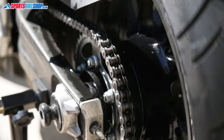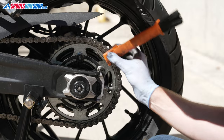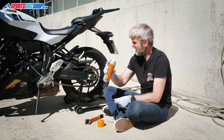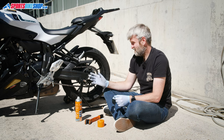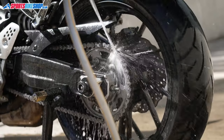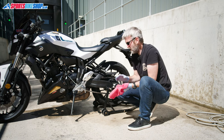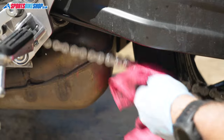Then just go around the whole chain — hold the brush and spin the wheel through it — to give yourself that extra lap and pick up anything you might have missed on the first circuit. Once that's done, the next step is to spray away all the gunk. You could do that with more chain cleaner, but I tend to use a garden hose at home, or a pump-up garden sprayer with water, to wash away the residue. Then I get a microfiber cloth or any old rag and, on that bottom run, I roll the chain through to dry off as much moisture as I can.